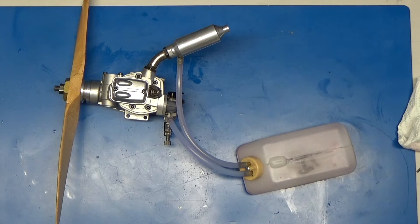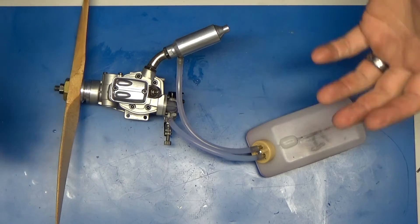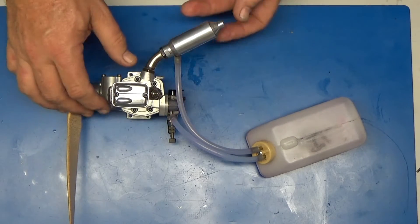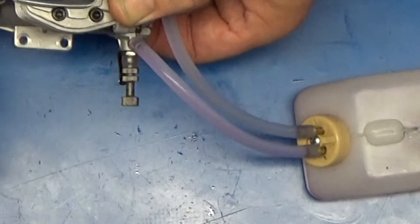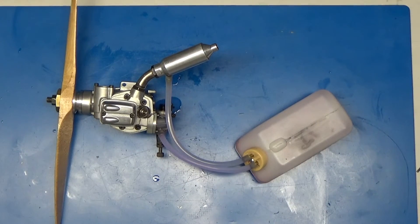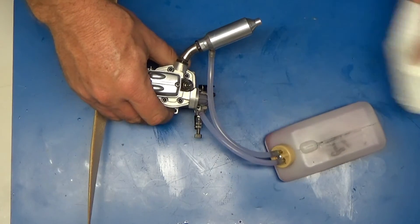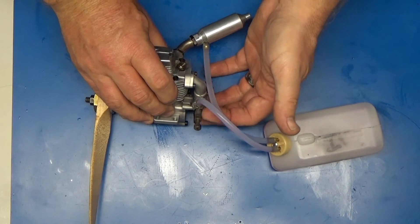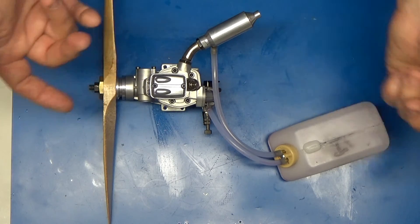One of the first things you want to look for if you think you have an air intake leak is when you go to prime the engine. However you prime your engine — whether you hold the exhaust port or what — you always should have the throttle fully open and cover either the exhaust port or the carb opening. Notice that all I had to do is lightly block this prop and it started drawing fuel. If you rotate the prop and you see that no fuel is coming in, that is a clear indication that you've got an air leak somewhere in your carb intake. It could either be at the junction of your intake manifold to the engine, or you might have a bad O-ring on your carb, or even a missing or really bad O-ring in the needle valve assembly that's not allowing enough suction pressure to actually suck fuel in.